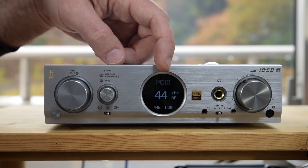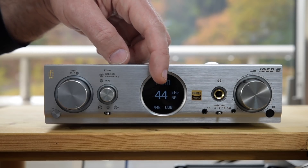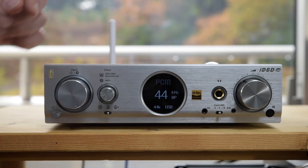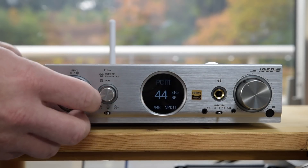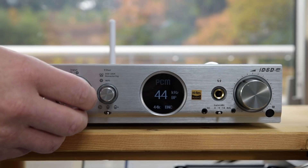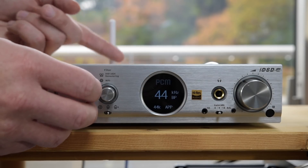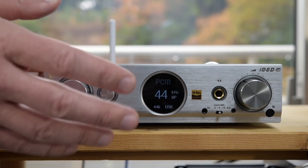Once it's on, the screen shows the status of the unit in a number of different ways. At the moment it's showing PCM mode and the current output frequency — 44 kHz because it's in bit perfect, non-oversampling mode. It also shows the USB input at 44 kHz. With the input selection you can turn through to the ones desired. It also shows an optical input — the box comes with an optical adapter for use with SPDIF. You also have the BNC input for the word clock, and the app input, which will automatically select whether it's wireless, wired network, or playback from the micro SD card or USB drive via the Muso app.